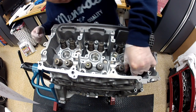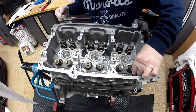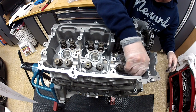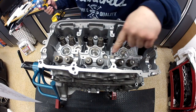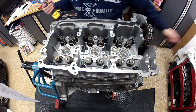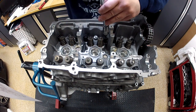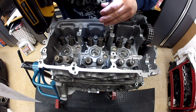We've got a washer and a nut — just going to hand-tighten these. All right, we have the nuts on all the studs, washers and nuts, all started. Now I'm just going to snug these down ever so slightly without any torque.